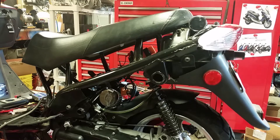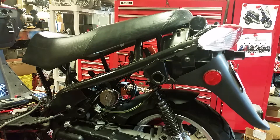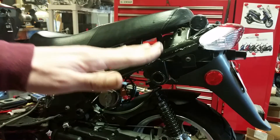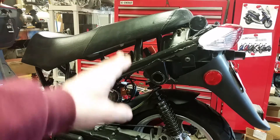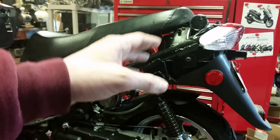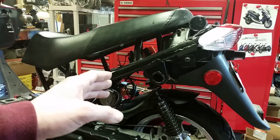Back in our last video, long story short, I installed an oxygen sensor. This right here is your gauge — it reports a number. Without going into details, 14.7 is what you're looking for; that's what's considered perfect AFR, air fuel ratio. I've got the 14.7 pretty much dialed in at idle — it fluctuates from 13.5 up to 15, but it's staying right around 14 with the 35 pilot.